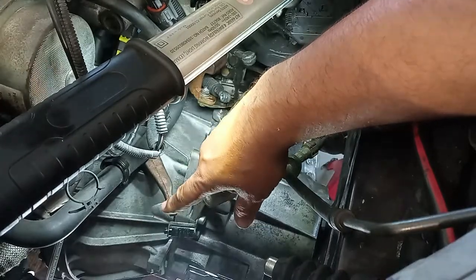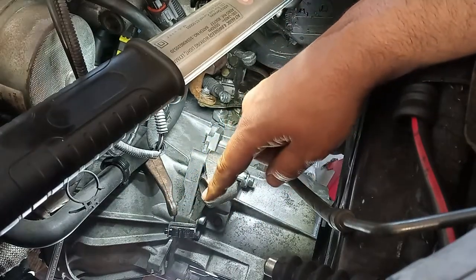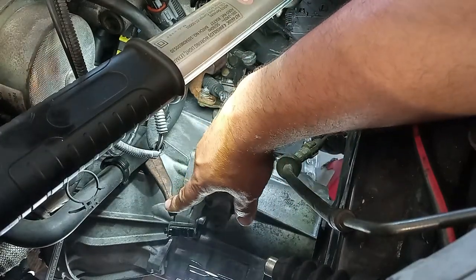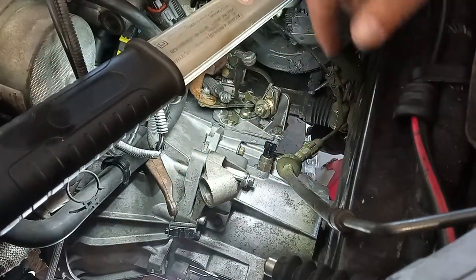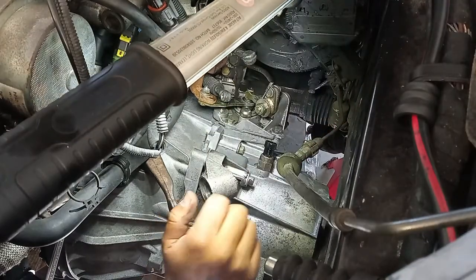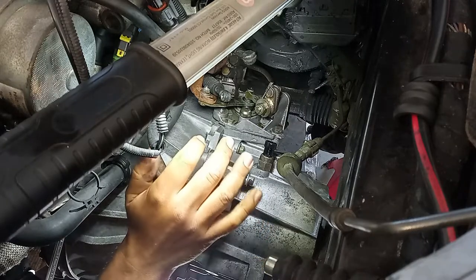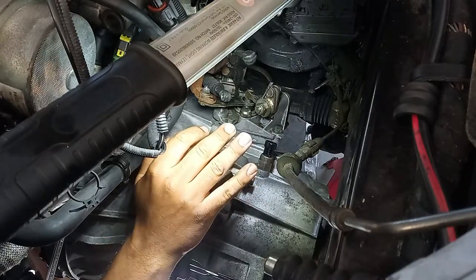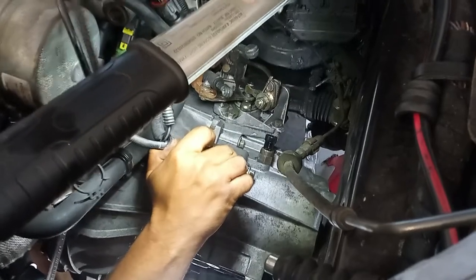I already have a video on how it works and how to remove it. If you want to know, it is down in the description, because if I fail on this maneuver, I will have to remove the gearbox again and re-engage that clip. So let's see if I am able to do that. Choose a good position to do so. Just touch here on the lever. Now with my palm, I'll do a very sudden movement with a lot of force. Okay, keep pushing.